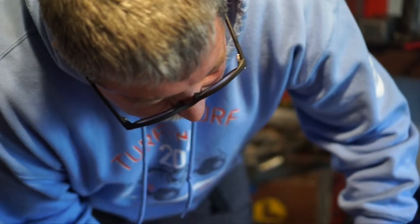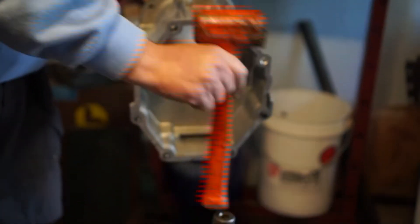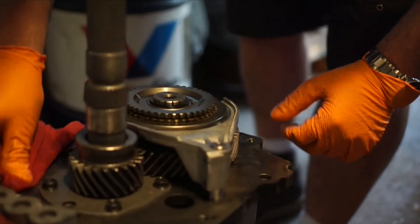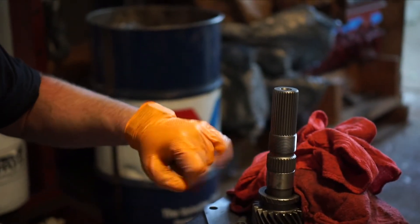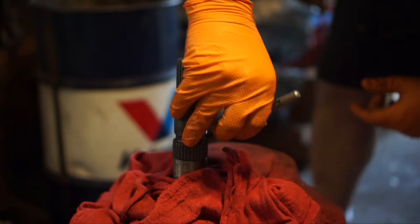We need to reuse these dowels right here — those locate the adapter so it's square with the shaft on the transmission. Prepping the surface — only the finest red rags ever. With the Toyota Land Cruiser transfer case adapting to the GM NV4500, there's two sets of splines, and this is the spline that we drive from. So we'll actually cut the shaft to just above that spline there — there's a measurement we've already taken and that's where we're going to cut it. That looks perfect.